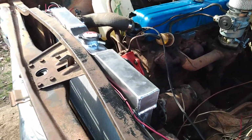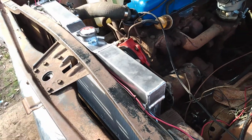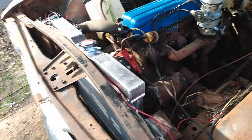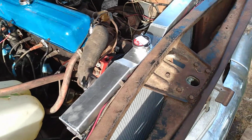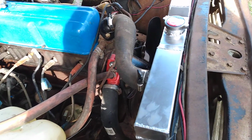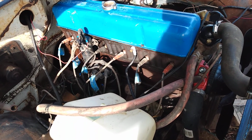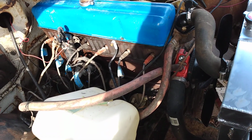As you see too, the radiator is new. I went and bought a Chinese aluminum, shiny, ugly, but yet functional radiator, because there was no patching the old one at all. Incidentally, when they took the old one out, it was very heavy, which leads me to believe it was full of a lot of junk, and it wouldn't have worked anyway even if I had it patched. I wasn't able to run the engine very long, and I was afraid it would be overheating, and everything was leaking out anyway. So we're going to wait for that JB Weld patch to mend and see how that worked out, number one, and number two, see how this radiator cools down the car.